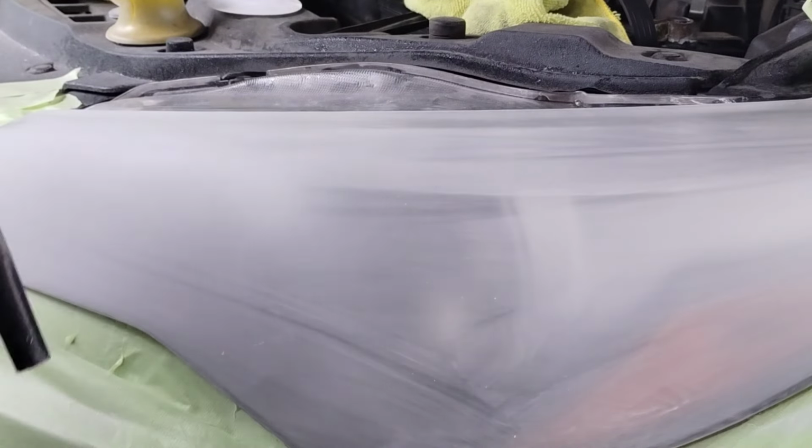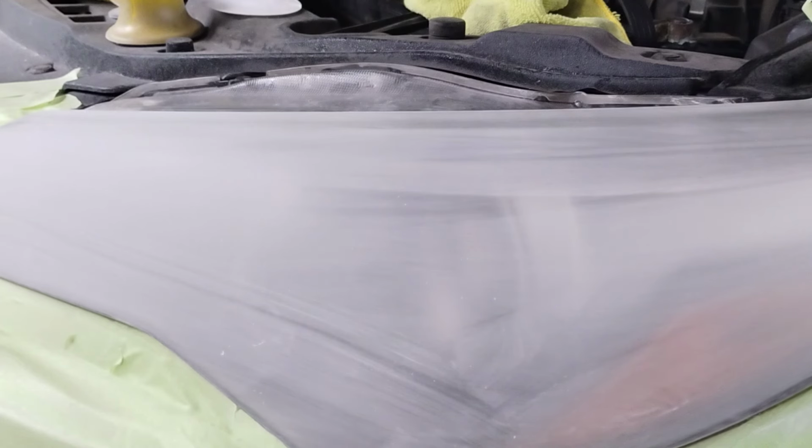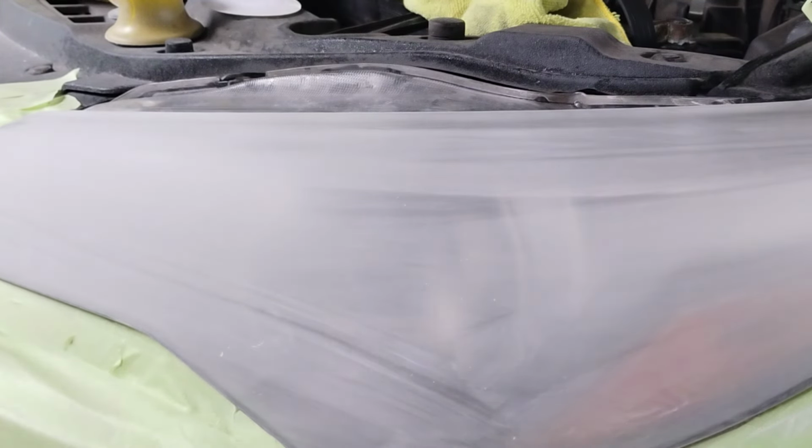When you're hand sanding, you're looking for that smooth finish, that real chalky, real smooth-to-the-touch type finish. This means a lot in your finished product. You want that crystal clear clarity. You're going to really pay attention to this spot as well, or the step, excuse me.